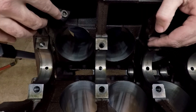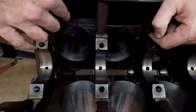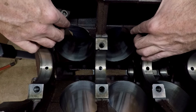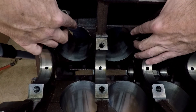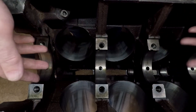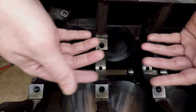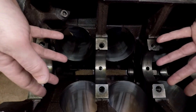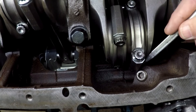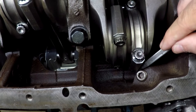Okay, I cheated and did a little of the work without you. It only took about five minutes and I really didn't want the camera in my way when I was trying to get some work done. I took the edge off the boss for the oil pump pickup, then just a little nip on each one of the bores and smoothed them out afterwards instead of having a sharp corner sticking out. I've got all the loose debris out of the block but I need to go back and completely clean all of this. I've already punched the cam bearings out and have all the plugs out of the block so I can scrub the whole thing and get it ready for reassembly. That's as close as it gets between the rod and the old oil pump pickup boss — we didn't quite have to get into the plug like I thought, but it was pretty close.